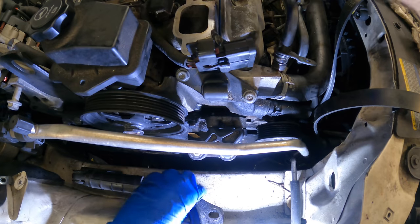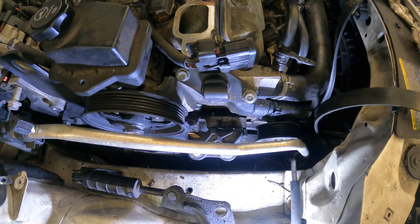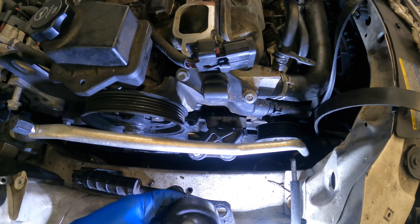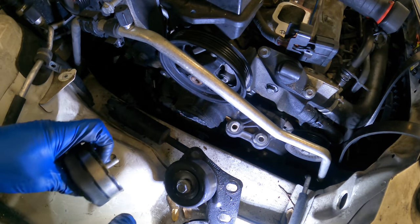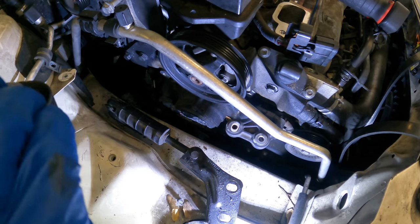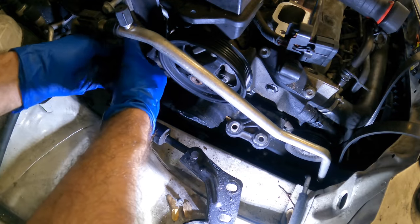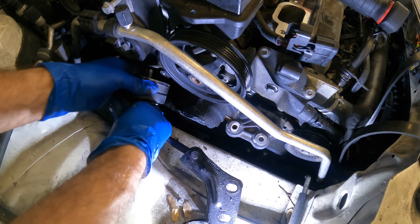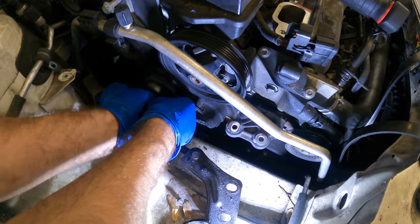There. Let's see, these guys, that goes there, but the belt routes around through that, so I will do that last. Which means I have to get a couple pulleys installed. I've got two more idler pulleys. There's one. And here's the other. Oh, shnikes, which one went where? Witness marks. Okay, that's got a whole bunch of tangs on it, and so does that surface there. So this one went in this position. That looks right. That means that this one goes down here in this position. Oh, I'm dumb. The bolts are different sizes, so I could not have gotten those backwards. Okay.